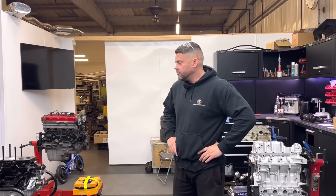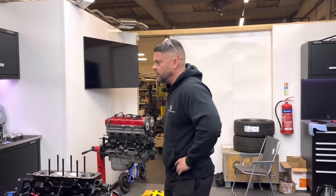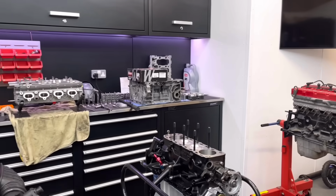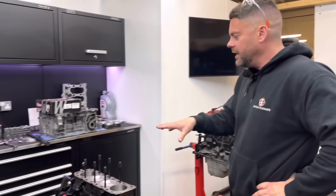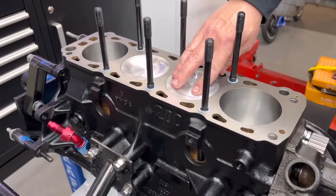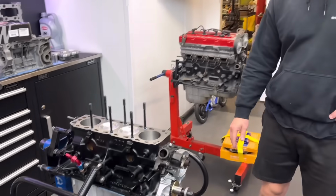Nice. So yeah, jobs like this Cosworth here, mate, where you've got not so straightforward work. You've got things like these solid lifters, something slightly different. Even modding the crowns of the pistons, I know I do them all the time, but it takes a lot of time, doesn't it? Yeah, it does. Head porting, all that sort of work. We get people asking all the time, through email and ringing up. How much for a quick port and polish? I mean, there ain't no such thing, is there?